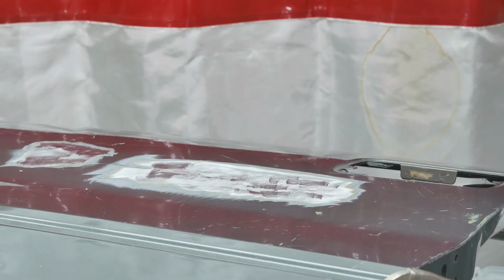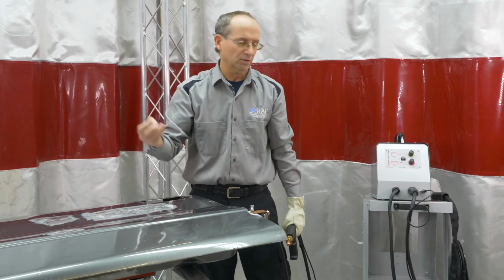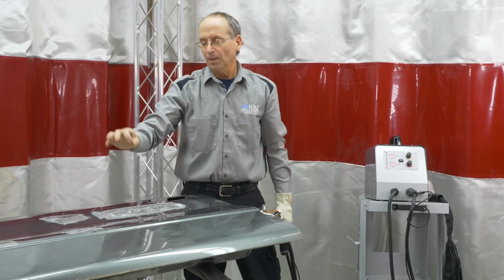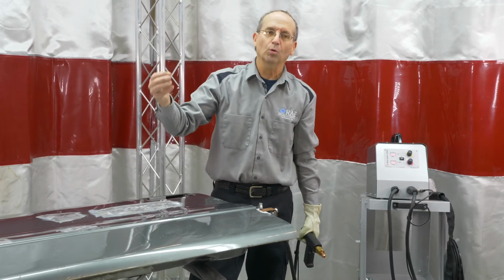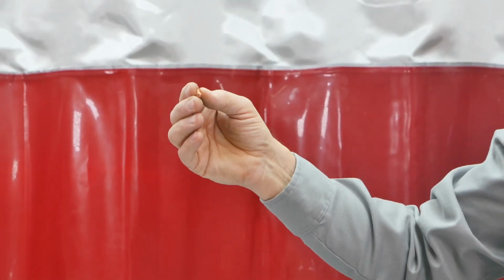If it comes right off, we need more power on it. This does require a little bit more because we do have a bigger surface here going on of the other products. So this one you would end up cranking up power and timer, testing on the type of stud that you have and the panel that you're putting on it. And these studs usually end up going on for holding some kind of wiring harness or a brake line or whatever bracket will be on there, normally in trunk floors, areas like that.